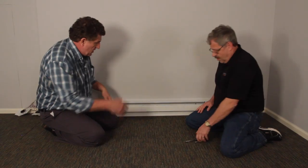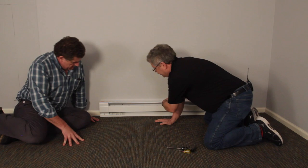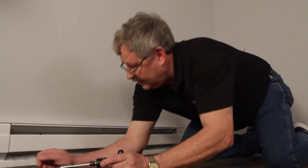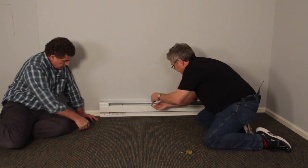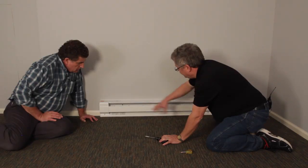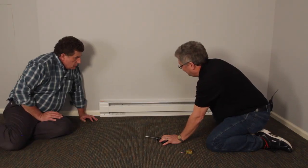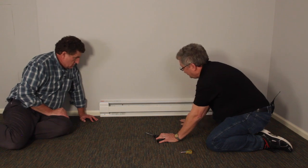What we're going to do is we've anchored this heater with two screws, so we'll go ahead and loosen those. Once it's loose, we have the two end plate screws and go ahead and unloosen this ground. Now that the element's loose, we can kind of tap it a little bit and let it align itself.